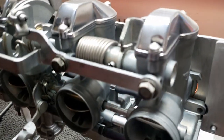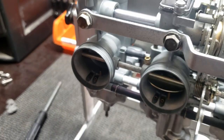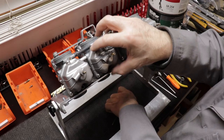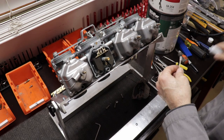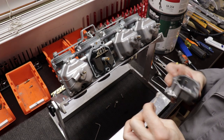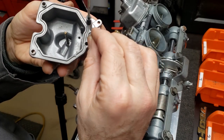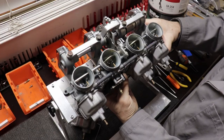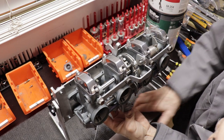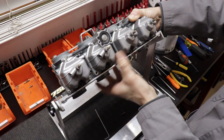We can see all the carb tops on and everything is clean. The rear stay bolts are still an issue but I'll deal with those, and I have two choke plates left to put on. We need to install the diaphragm pump on carburetor number two, so you can see we're taking the float bowl off. I'm making sure the shaft for that diaphragm pump is lubricated — there's a small bellows-type seal that goes in there as well. It's all serviceable, not as pliable as I'd like, but it should be okay for the initial start.